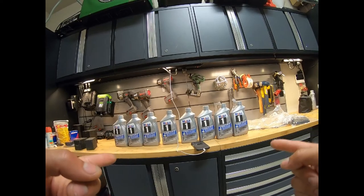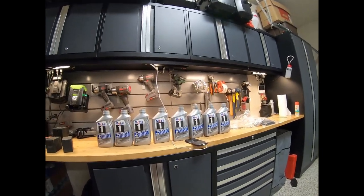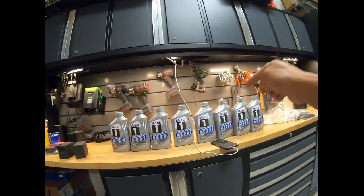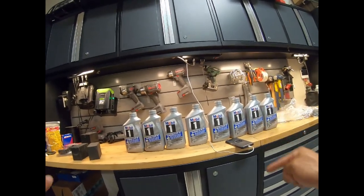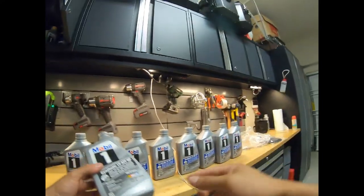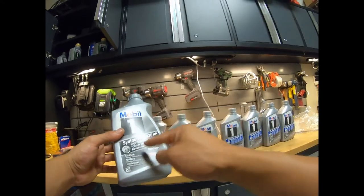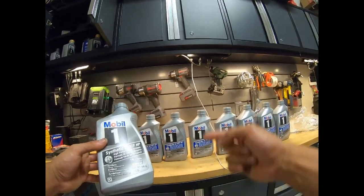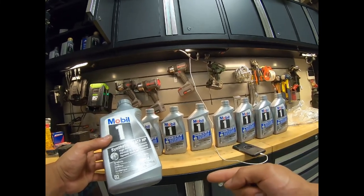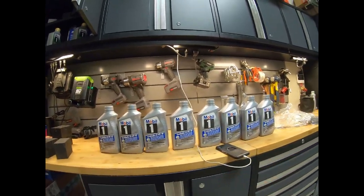There is a very good YouTube video by Weber Auto — they teach you a very in-depth way to do this. I'm just going to show you how I do it from start to finish. I want to make an important note: this new blue bottle is the latest formula, released in January of 2019. I stocked up on the previous one. If anybody's trying to sell you the black-labeled one, don't buy it. GM found out that even though Mobil One made an improvement to the old AC Delco LV ATF HP fluid, it was still breaking down because it was too hygroscopic — it was taking in too much water over time. So this new improved formula from 2019 is what you need for any GM car with an 8-speed automatic transmission.